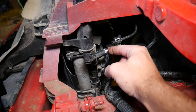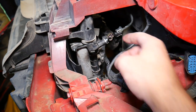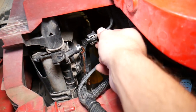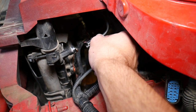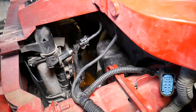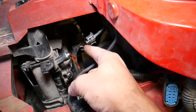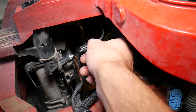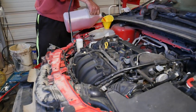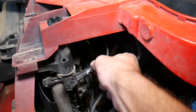Get a bucket to catch the overflow. We want to make sure that there is no air coming out of here. Always use gloves — don't touch the coolant with your bare hands. Make sure there is no air coming out. You can see more air now — all that is collected in the bucket. I'll close it for a little bit. What you're striving to do is to have no air at all — no air coming out of the system. Add more coolant; you have to keep the coolant overflow bottle filled.